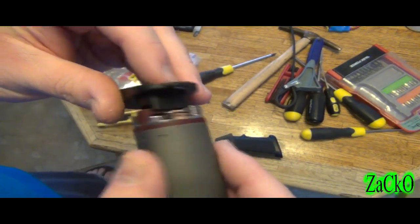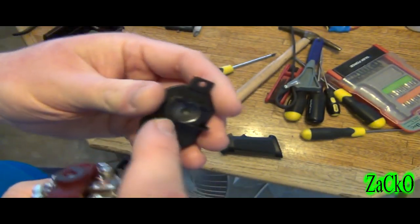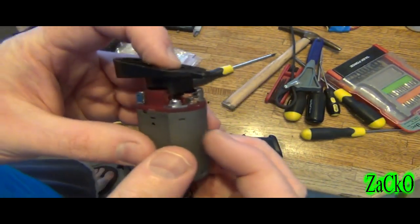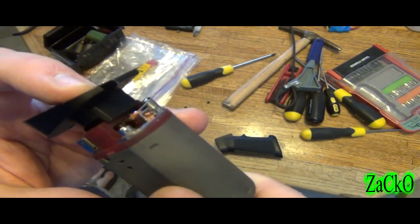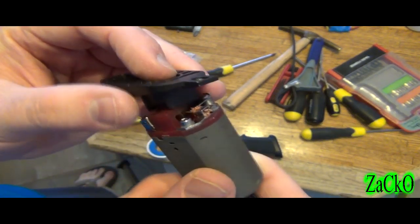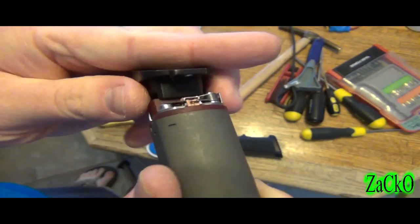If this is pushed back too far you can see that the metal on metal right here is not good. The only thing that stops us from shorting is that it's painted, so I would suggest to cut those off so you never have an issue at all. You may also have an issue down here with the contact at the end of the brush — sometimes the metal that holds the springs in place touches.